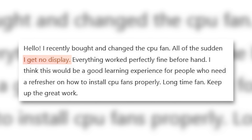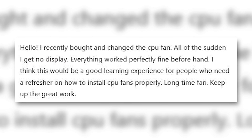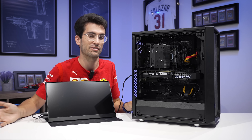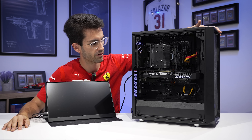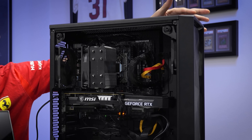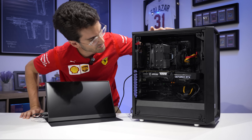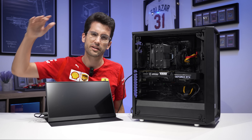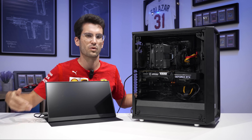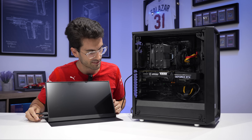From the description, the rig apparently powers on but doesn't send a picture to a monitor — maybe it's posting, maybe it's not. I have a good feeling that if there's actual socket damage, the system is just not going to post at all. Three, two, one. All right, so far so good — all the fans are spinning. I don't hear anything settling down though, so the fan curve is still ramped up at the same RPM it started at. Usually it'll tone itself down if the system actually posts. It does sound like the system is not actually posting.